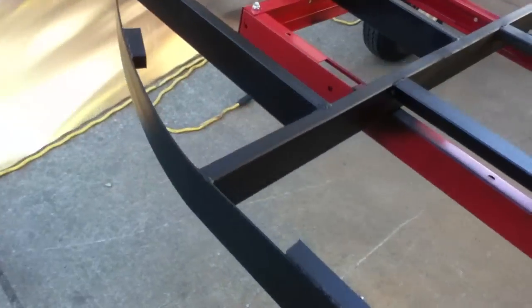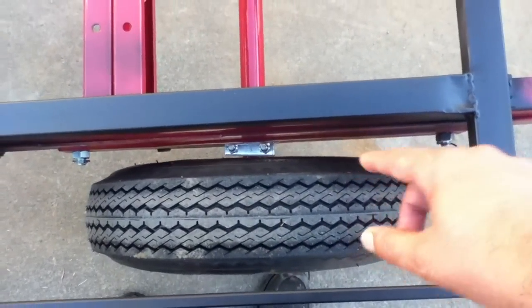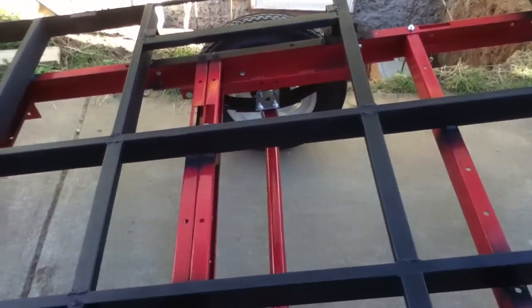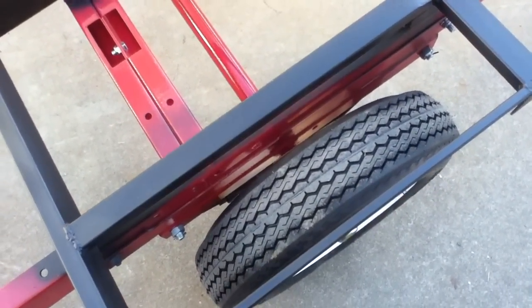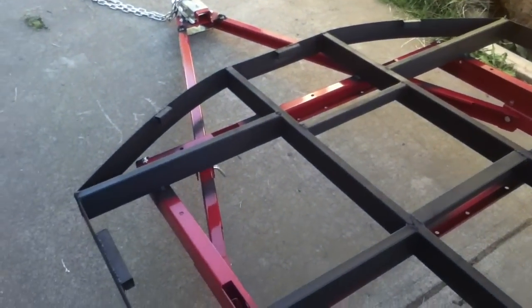Something I ran into that I don't really like: even though I followed all the instructions on the trailer kit, the axle is a little bit misaligned. I can see it's a little wider here than there. It may not matter a whole lot with the type of hauling I'm doing — it's a single trailer hitch, basically a three-point setup — but that kind of alignment issue does accelerate tire wear. These are 80 PSI tires that I expect to last a long time. With the reinforcement pieces all welded in, the next stage is decking.